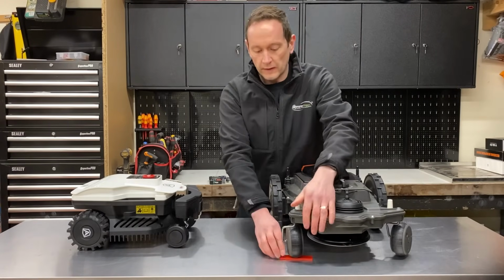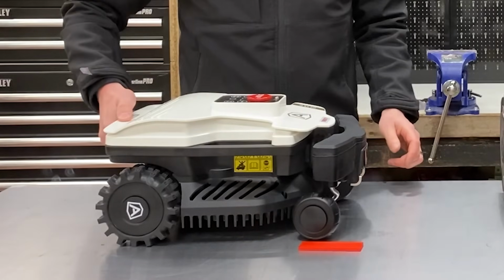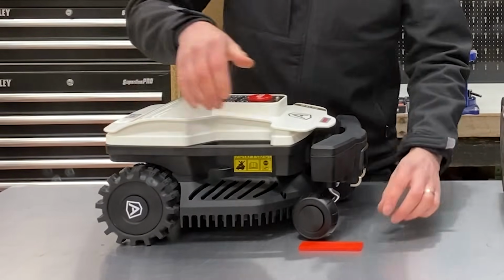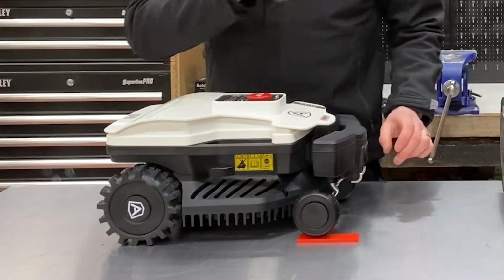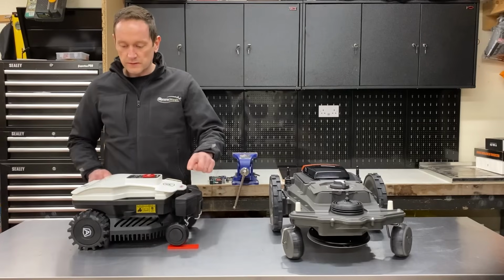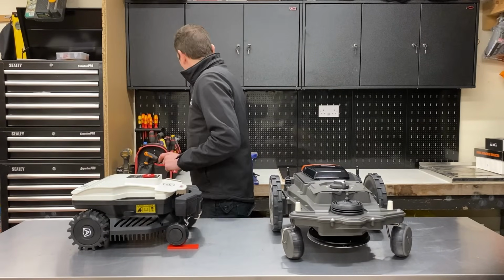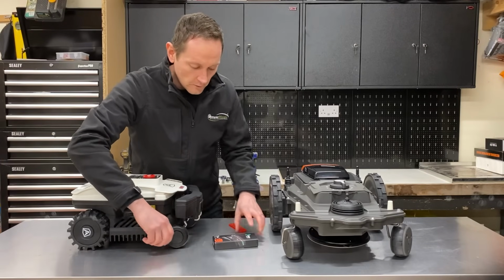If we do the same thing on the Ambrogio, you can see that there's a twisting mechanism that allows the robot to ride over undulations in the ground. So if I put a 5mm packer under there, you can see there's absolutely no loss of contact on any of the wheels. In fact, the travel has 25mm of movement in it.